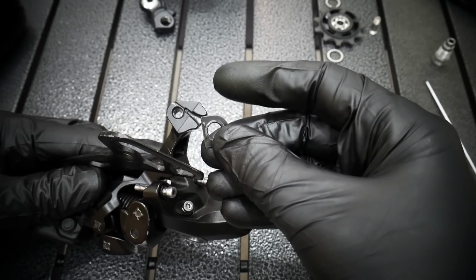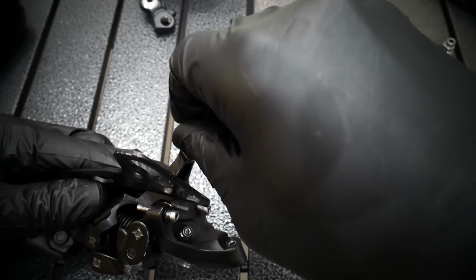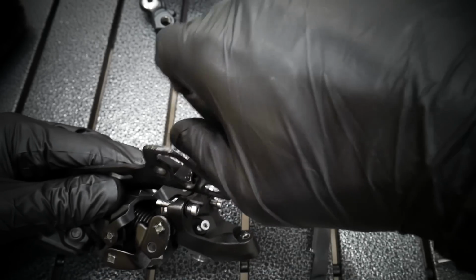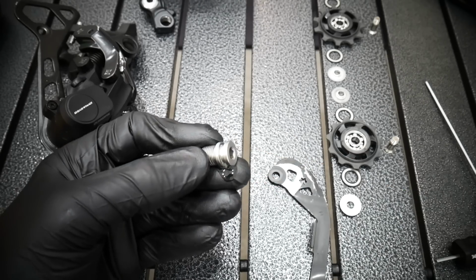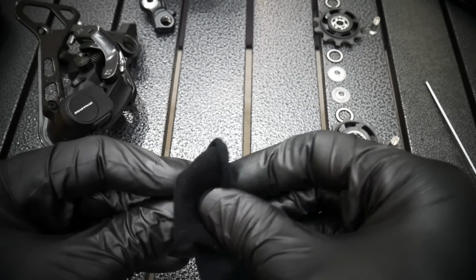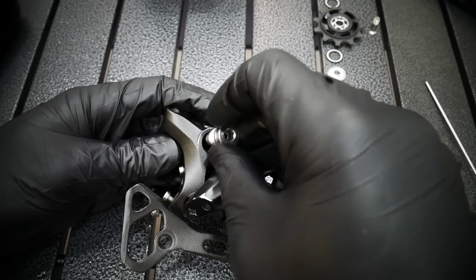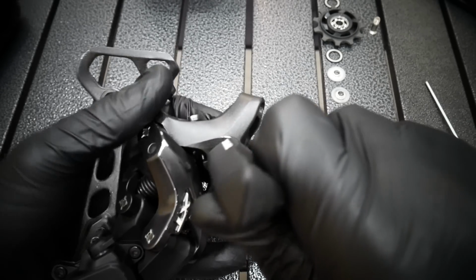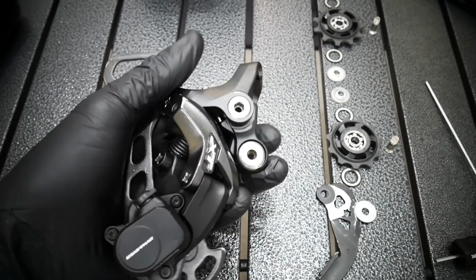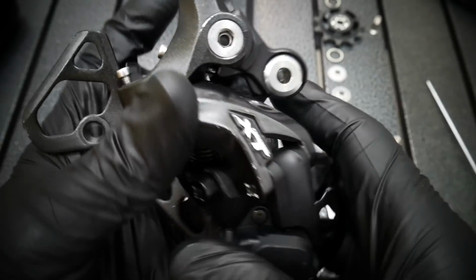You can see which side was going towards the bolt. There is no black paint there. So now the bolt for the cable, and we are almost done. Now there's the axle for the bracket. I'm putting some Brunox there just for cleaning and making sure it's dry. So this is how the bracket should move. And now the axle, you use some more force here. Cool. The bracket should be free, almost without play. There is almost no play when the axle is there, and the bracket is totally free, no resistance there.